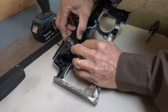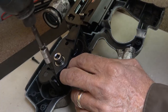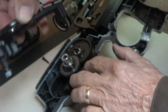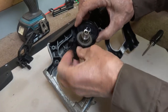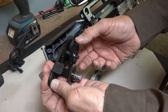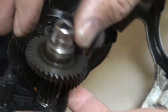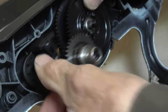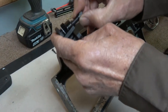This top half is a cover and it will lift off. I'll get the screws out of the way. That's your cover. And this is your AccuSlide assembly. Your belt is attached to that big pulley here, and as you can see there's a lot of rusty area on those teeth. This is after I've already cleaned this up once and lubricated it. What had happened was that water migrated into this AccuSlide system and got into this piece.